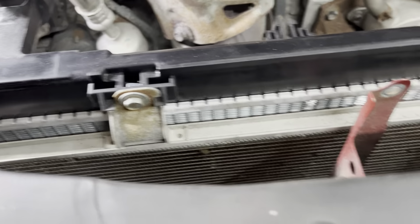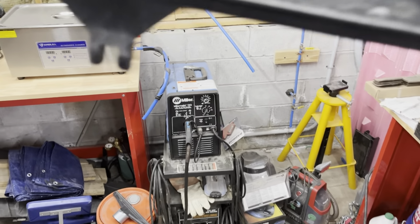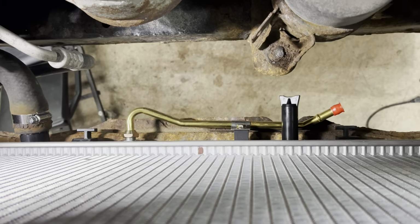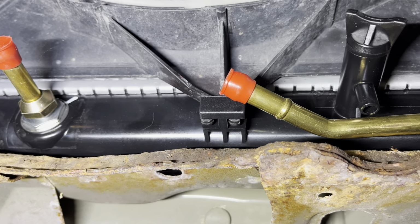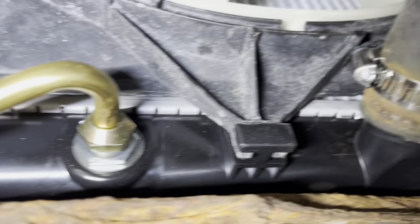All right, got the condenser actually connected. All 4 bolts are connected. Next is the fan. If you look at the fan on the bottom, there's these slots, right? They go onto the T's at the bottom of the radiator, one on the right, one on the left. All right, we're gonna slide this down in. Hopefully it'll be easier than when we took it out. Because I was doing most of the job with the car up on the lift, I can get underneath it and make sure these two T pieces engage. Looking good.